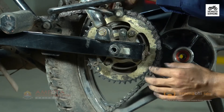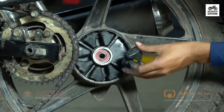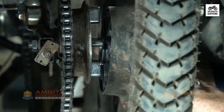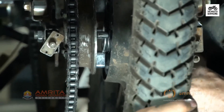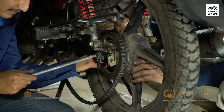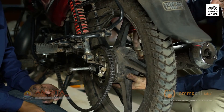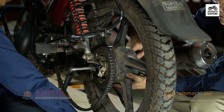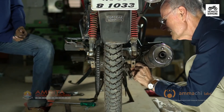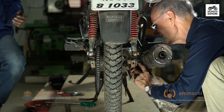Place the chain over the rear sprocket. With two persons, move the tire into place. Check that the rubber triangles are oriented to receive the aluminum section walls of the sprocket holder — it may take some time to align it perfectly. Once in place, one person holds the tire while the other slides the axle into place. As the axle moves through the tire, place the spacer onto the axle before it enters the chain adjuster. Once in place, put the angled washer over the nut end of the axle, loosely thread the axle nut, then gently push the axle into place and tighten the axle nut.